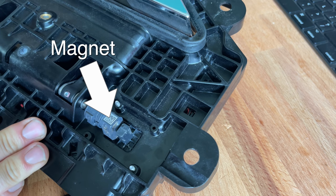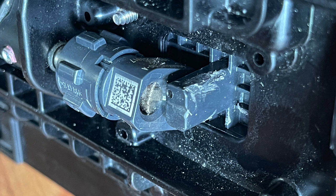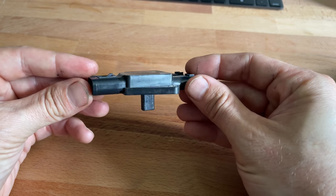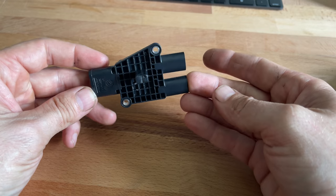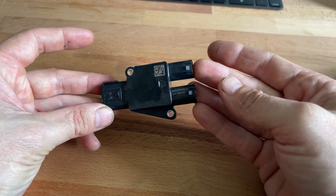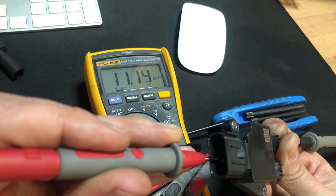This handle has a magnet that sweeps by this sensor. I know that this is a magnet because there is a constant supply of metal shavings floating around my garage, and so anything with magnets gets real obvious — like Apple uses lots of magnets. But how does this sensor work? Is it a magnetoresistive sensor? Is it a Hall effect sensor? I don't know — I am a simple mechanical engineer. I don't deal with invisible fields because if I can't see them, they must not be there. There are six wires going into this control board, and as I said, there are four wires inside: two for the motor, two for the LED puddle light. Using a multimeter, I determined that two of the wires go straight through to the motor and two go straight through to the LED light.